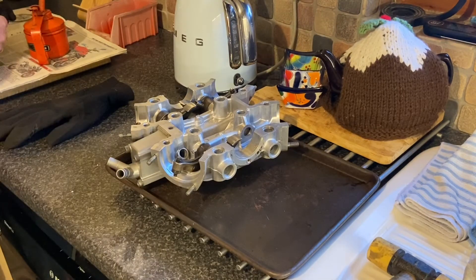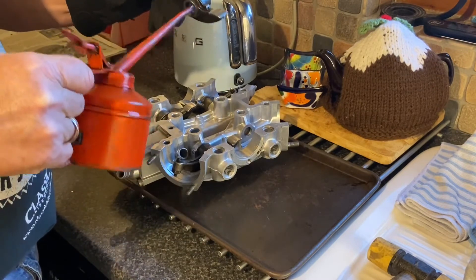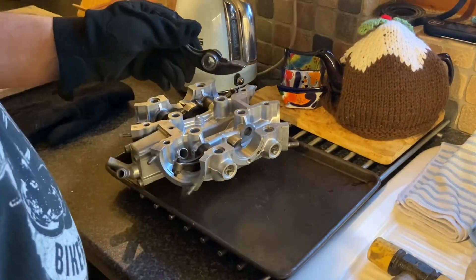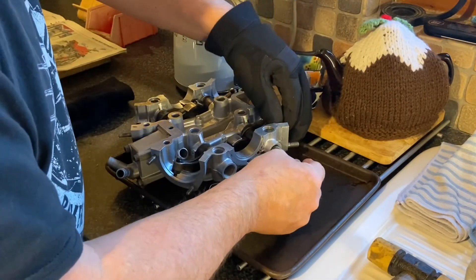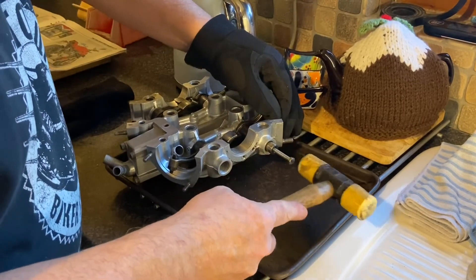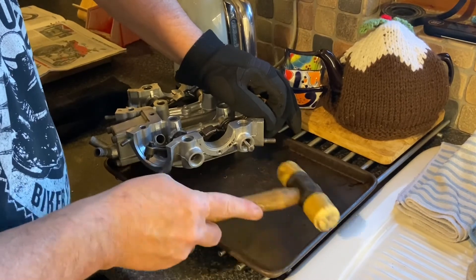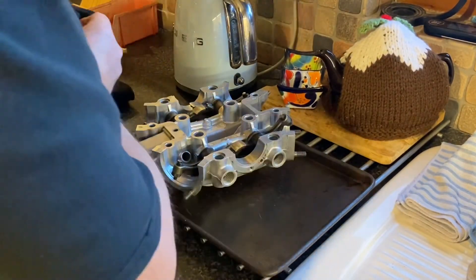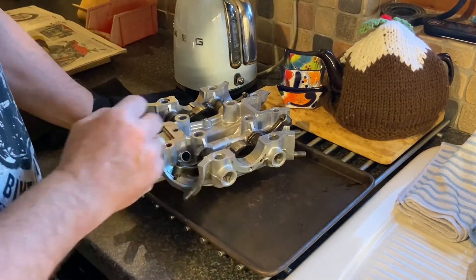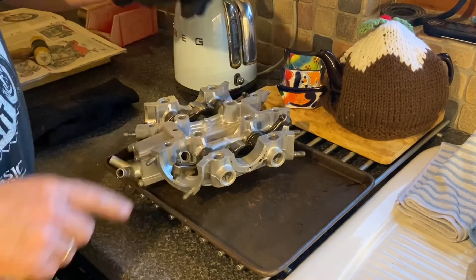Last one coming up — oh, it's getting a bit hot. Screws in the bolt. Castrol R is on the rocker and in it goes. Unit seating — that ting as it gets into the end. And then the screws go in there to hold the whole thing in place. The camshaft sits along here like that. And there you have it — rocker is back in place after 15 years plus.